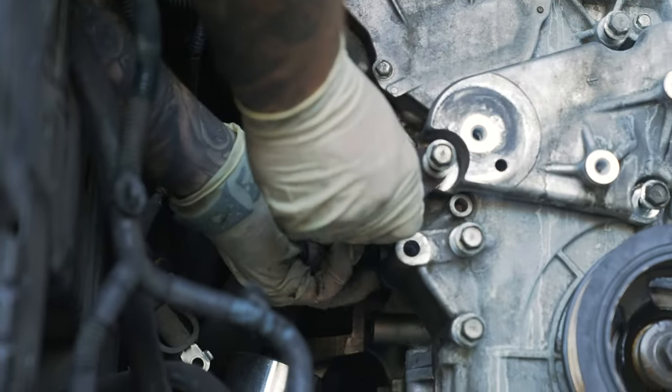Now we will install the water pump. The gaskets are in, it's time to do the water pump. When you pull the water pump out it always drops a bunch of coolant. The lower pan is open so the runoff is going to want to go into the motor. I take a little piece of tape and put it under and kind of tape it like that to try and direct as much coolant out of the inside of the motor — you don't want a bunch of coolant going into your block. That kind of just helps the coolant stay out of the block.